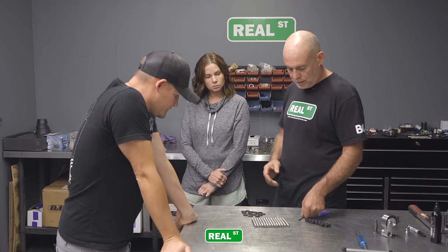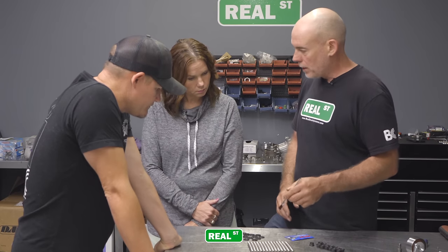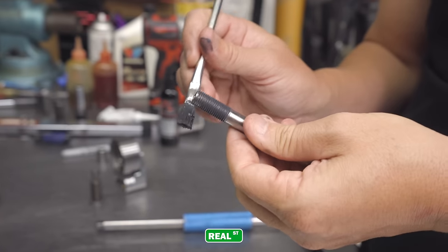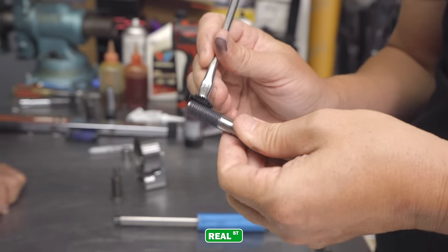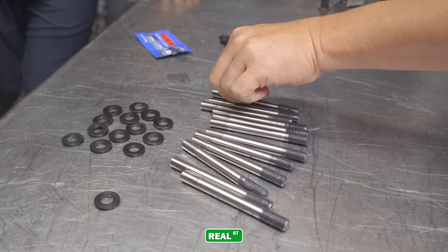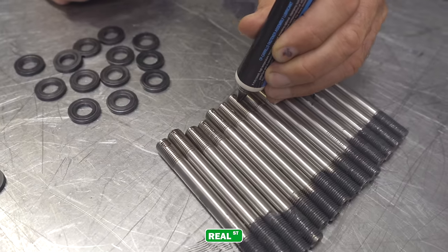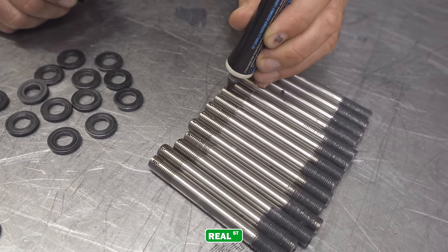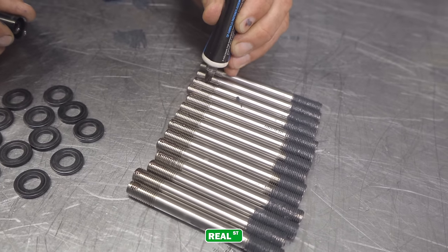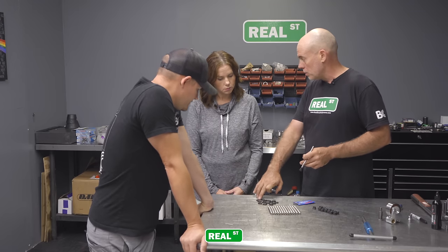We're going to lubricate it with the ARP Ultra Lube. When you put this lubricant on the threads, the object of the game is not to overuse it, because this is going to end up in the oil pan. You just want to paint the threads and the friction surfaces, and make sure there's enough present that when you assemble the engine, the friction surfaces are covered with the lubricant and you don't have unequal torque. Different lubricants will have different amounts of friction as you tighten the fasteners. Tightening the fasteners wants to shear the lubricant away. That's how you get those marks.